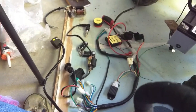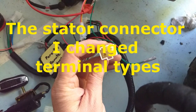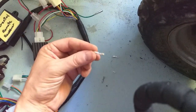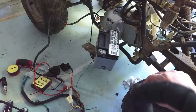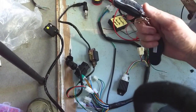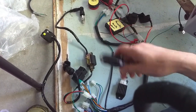I'm going to throw all of this stuff on here, minus the stator, which I'm reusing the one inside of here which has six coils. This housing terminal did not come with this kit — it used to come with bullet terminals on there and I cut those off with just a wire clip and then put on my own terminal. Then fire this guy up, hopefully I'll be able to use a little bit more than the key battery itself. Also, for the remote, if you have the remote, the battery itself is going to be A27 for this particular kit.